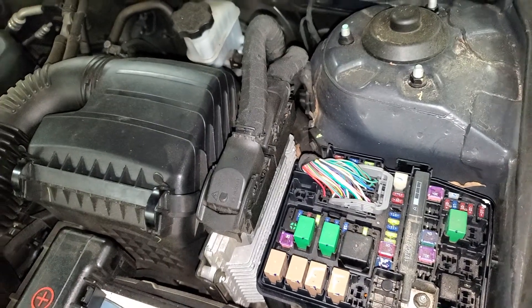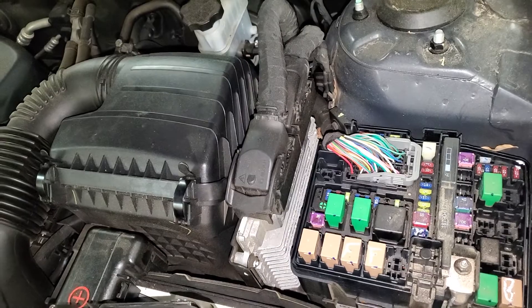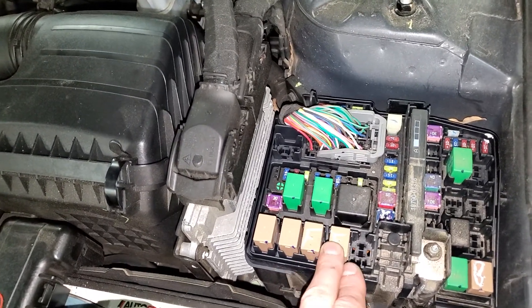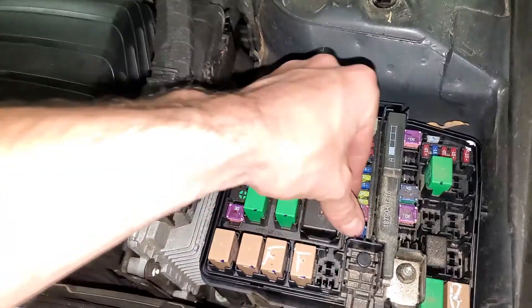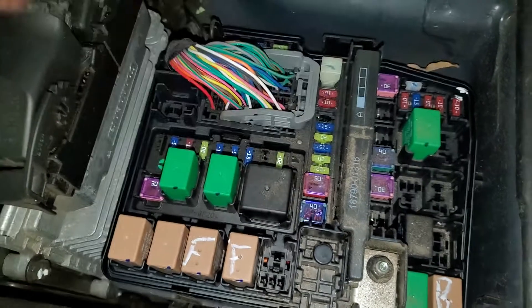For the air conditioning to work properly, your cooling fans have to be working well — they have to be coming on and moving a lot of air to keep everything cool and cool that refrigerant down. As far as the cooling fan relays go, there are two of them right there. And there is one J-case 40 amp fuse, and that's going to be that one right there — that is the cooling fan fuse.